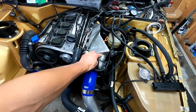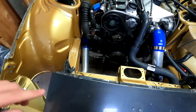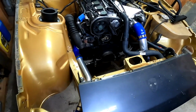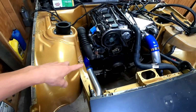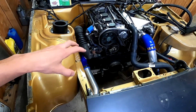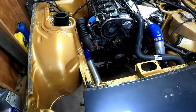Custom intake manifold. Then moving down to the oil pan. To get the oil pan done, you need to re-weld your oil pickup line and the oil pan itself. I got the link for the oil pan down below. Also the baffle I used, it's also in the description down below.